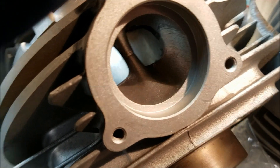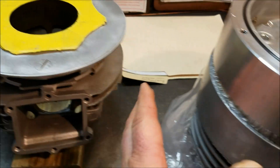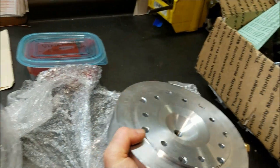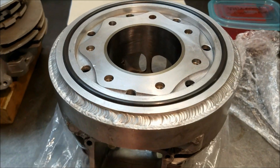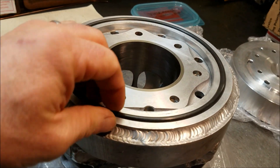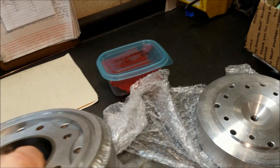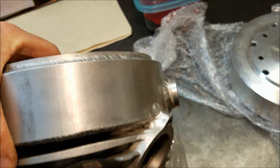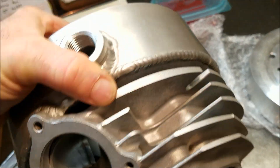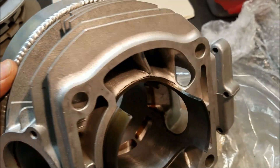You can see what the factory looks like — nothing crazy — but this is being cut so I can install a cooling jacket. There's a lot of work involved in this. The last cylinder here probably has 40 hours in the porting work alone and a ton of hours in the cooling jacket setup. What you're looking at here is the jacket has been added, along with a bung I make for the water feed from the water pump, welded on the bottom of the jacket.